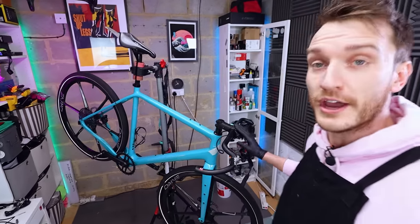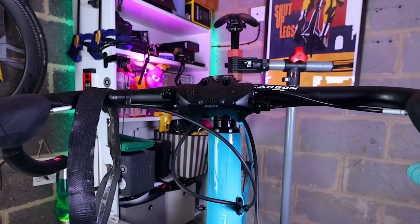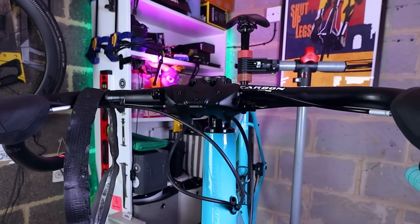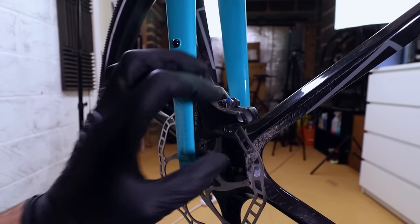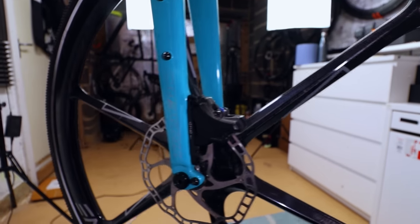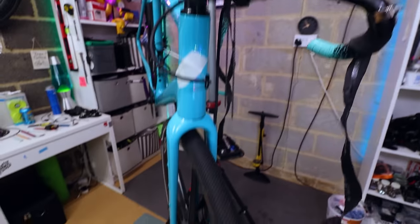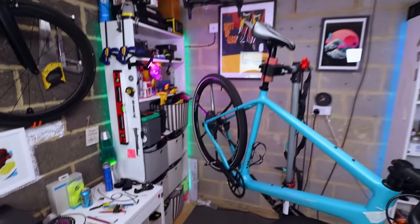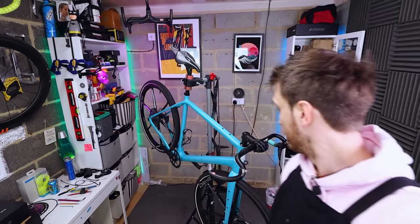Next I need to get the Conduct kit off. I've installed quite a few hydraulic groupsets but never uninstalled one. My plan is to unscrew the bleed nut, put a bag on the end to catch the oil, undo the line nut to release pressure, and let the oil drain out front and back. Then I should be able to pull the Conduct kit off the bike.